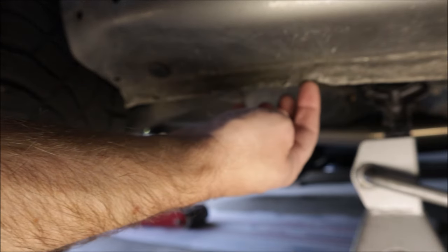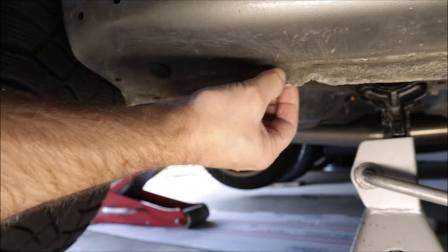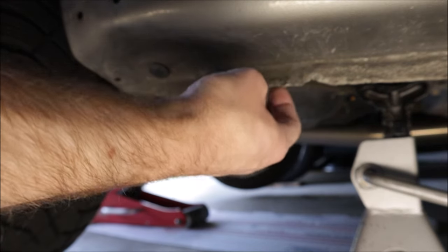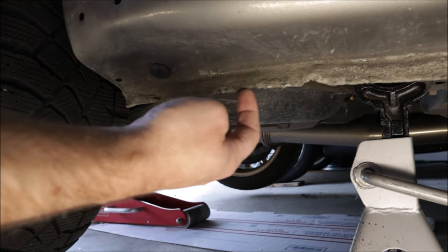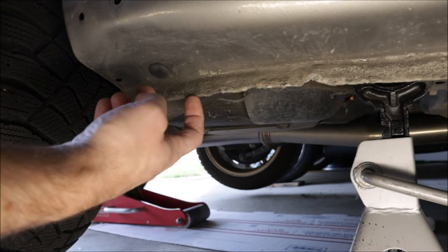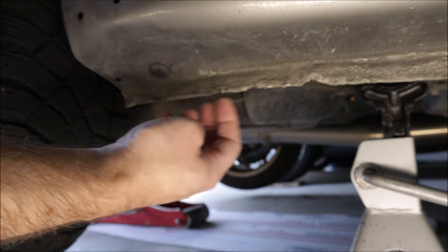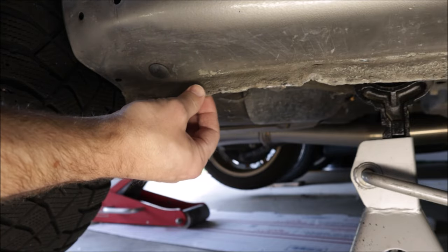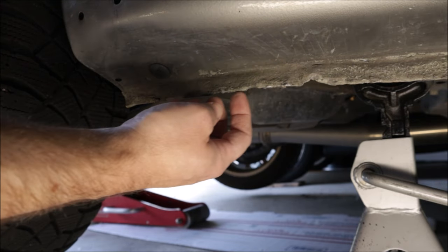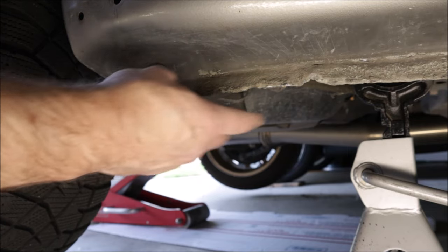This car is super rust free. If I had any kind of surface rust forming in between these pinch welds where all the metals come together, the best course of action would be to spread them open a little bit, get in there and sandblast all the rust away, clean it up, and then treat it with some rust inhibitor or rust converter — then prime it before you push it all back together because you don't want that rust being trapped in there. But this car is almost 100% rust free, there was nothing in there, and it's not going to get much use in the snow or even the rain. So we're going to be okay.